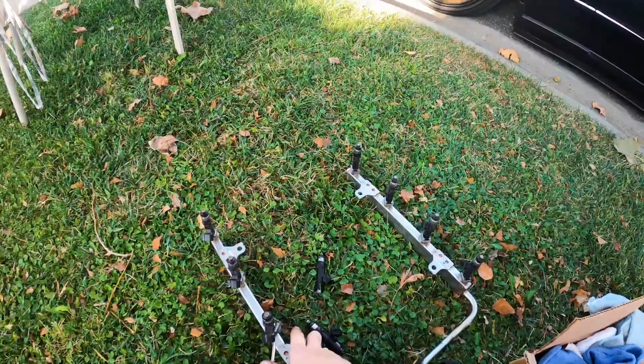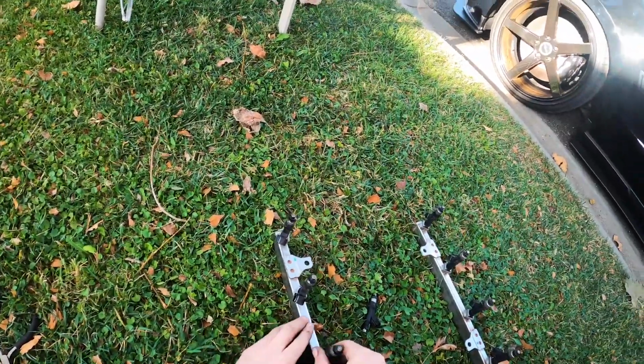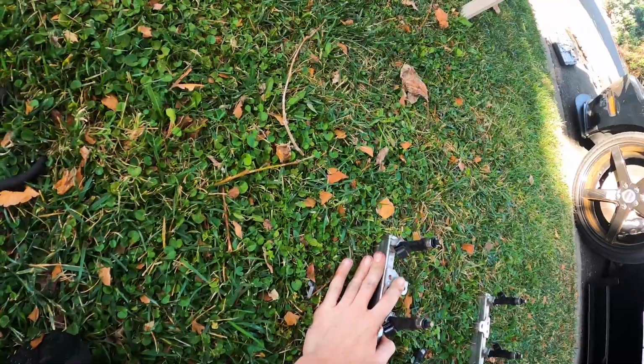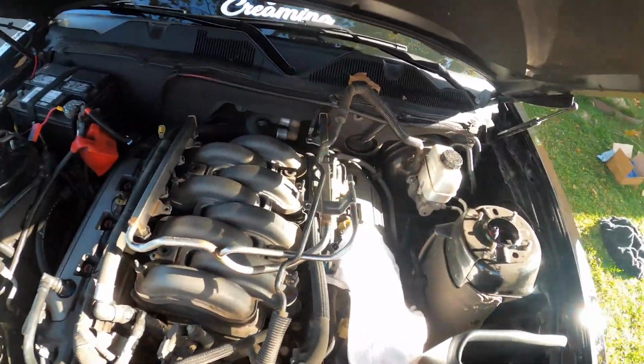How lovely. I'll link the tutorial I'm following in the description, but basically, the guy mentions the pressure, at least in theory, is going to be the most on that first injector. It's still not all that light, and I'm still covered in gasoline, so that's dope. Go, that makes my life a little easier.